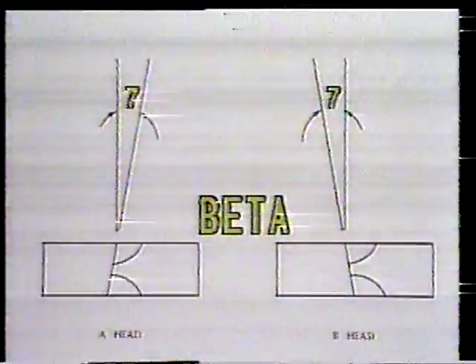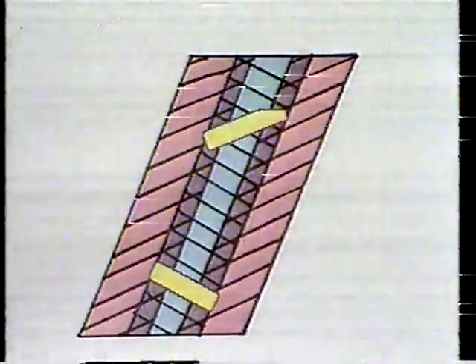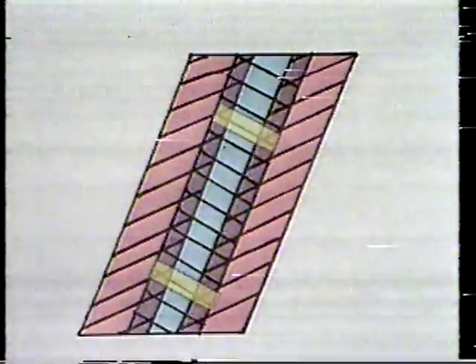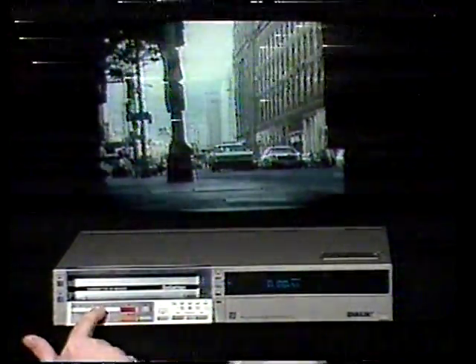In the original azimuth recording, each video head was slanted seven degrees off center to eliminate crosstalk from overlapping adjacent video tracks. When a videotape is still framed, both video heads track the same video path — but one head has an azimuth that corresponds to the tracks on either side of the one being scanned, introducing jitter and noise. The solution involved giving the second head a double azimuth. The second head's azimuth is selected depending on which mode the SL-2500 is in. In slow motion, both heads pick up the track being scanned and ignore the interfering tracks on either side.